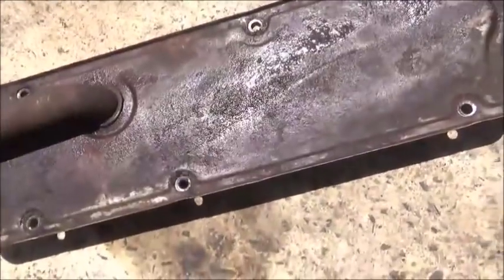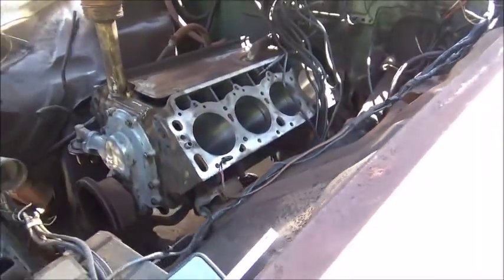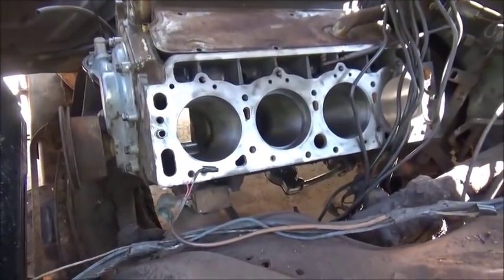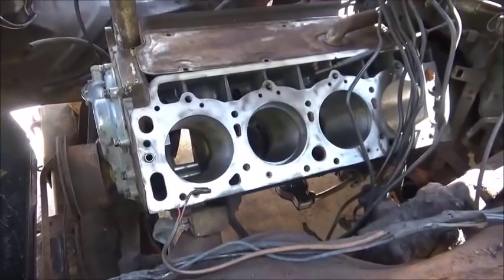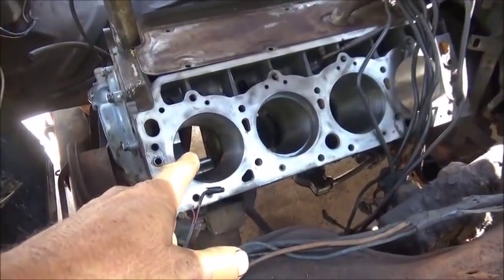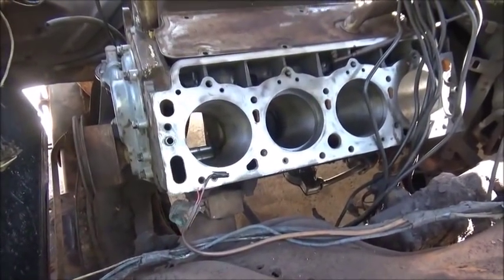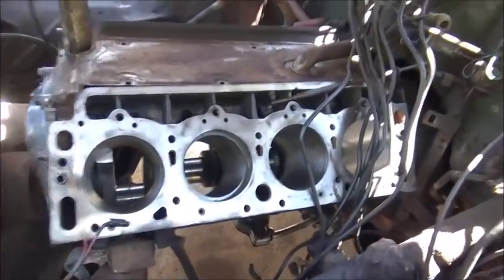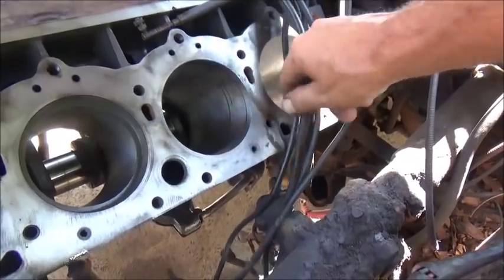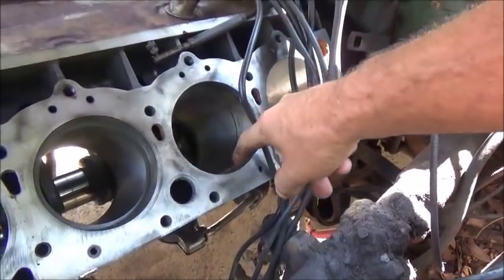Just cleaned up. Here's where we are - we've got her honed out, got quite a bit of it cleaned up. What I did was take some rags, soaked them in oil, and put them in the bottom of the cylinder so that anything that came off the blade hone would get stuck on that rag. We've got a couple places discolored a little bit where the top ring groove was, but you can't feel it.